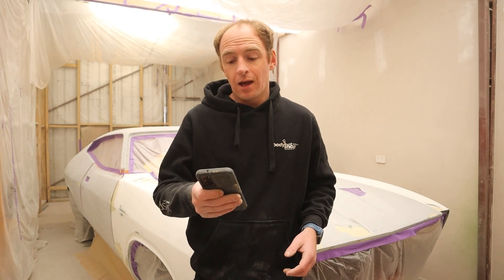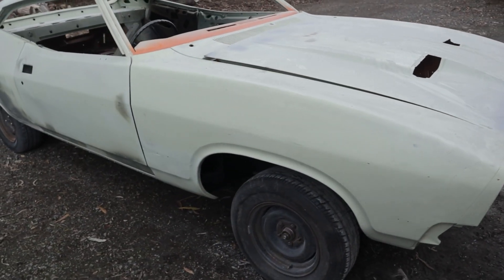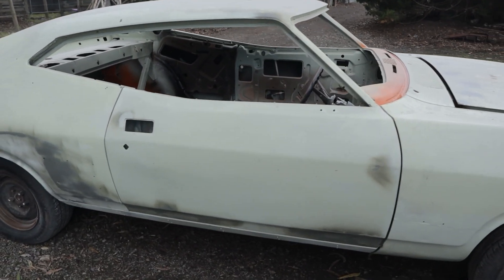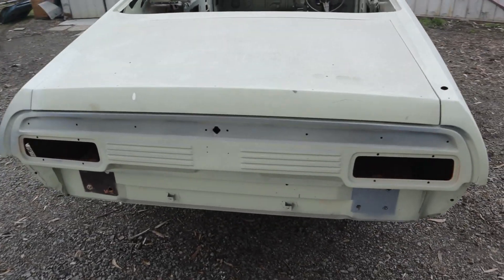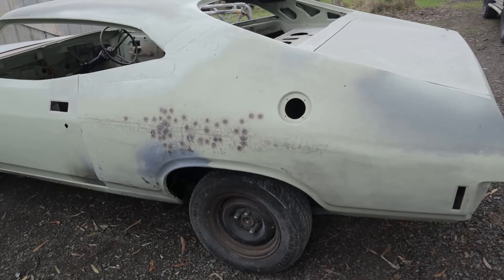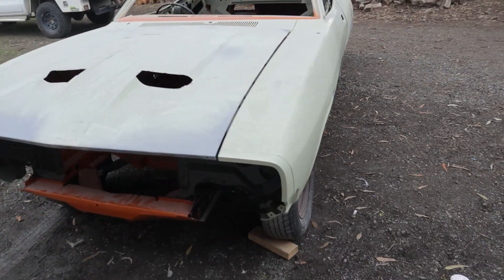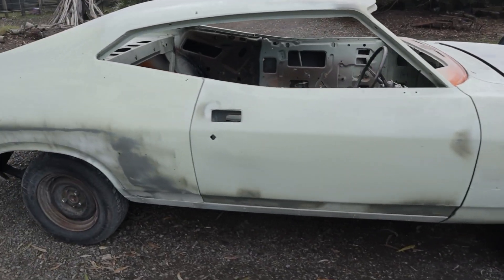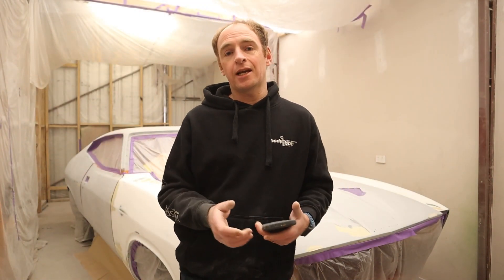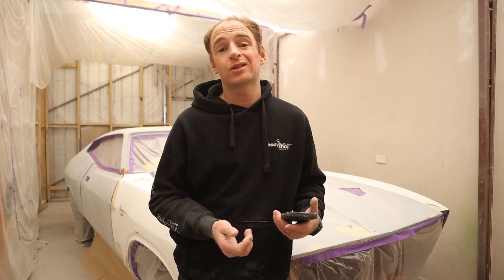The first question is: how much work is involved in doing a bare metal? Well, lots. If you want to do things properly, I do recommend taking a car back to bare metal, because at least then you can start fresh. On a lot of cars, especially old cars like this coupe, there could be a lot of rust underneath the paint. A lot of old school people back in the day, and when people do cars up on a really tight budget, they might just bog over rust — I've seen it happen before and I've had to actually fix a lot of cars where that has happened. Taking the car back to bare metal does increase the workload, but providing you do things properly, you can usually get a pretty good job, and if it's done right it will last pretty much a lifetime.